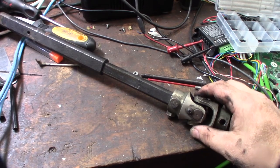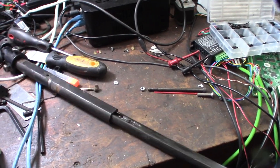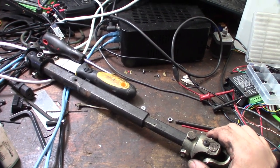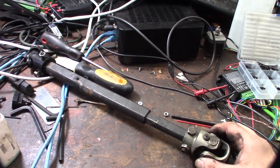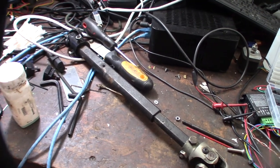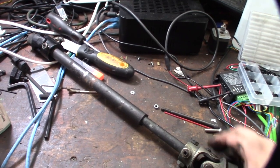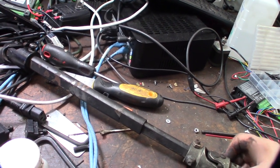So I'm going to go through what my idea was. The zerk fitting holds onto that thing right there. You kind of typically want it to articulate. When your body is flexing and your frame is flexing at a different rate, you need to have some play in there so you don't jack up your steering gear — you don't want to be ramming this thing into the steering gear. The steering wheel is probably fine, but there's play in the upper steering shaft.